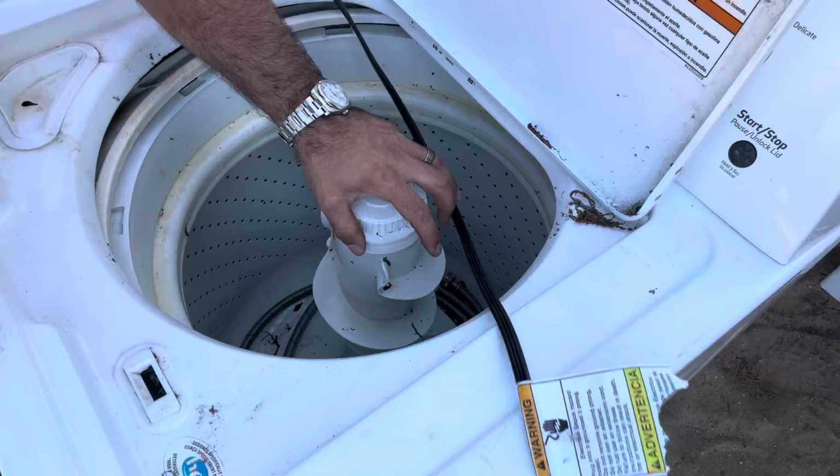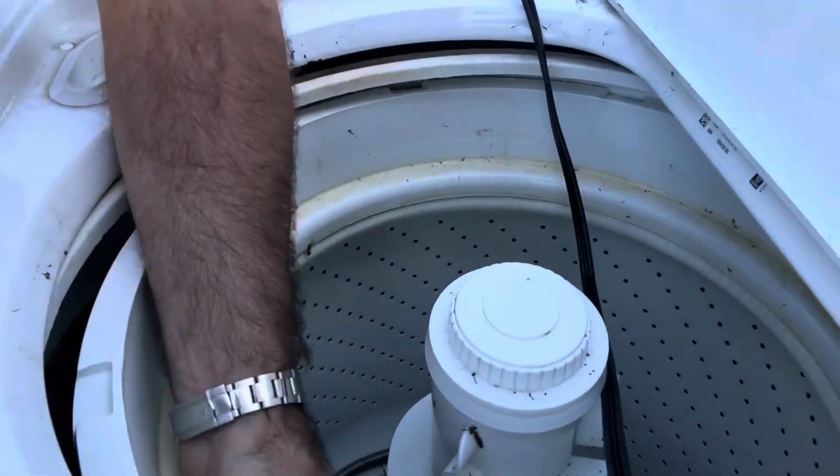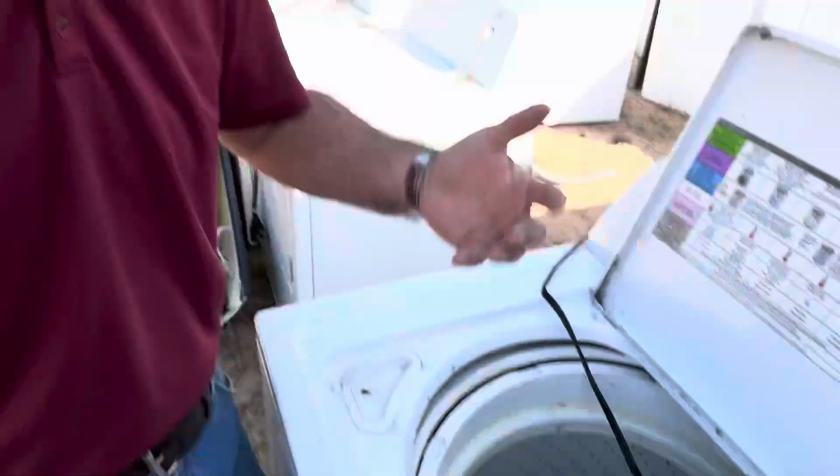So yeah, I changed lots of suspension rods. We're gonna change some on this one. Look at this. Those are definitely bad, but look at the drum. They actually broke the drum. So I'm gonna have to put a drum in this one because they let it go so long. But yeah, sometimes it's 2, 3, 4 sets of suspension rods in a day. Woohoo!